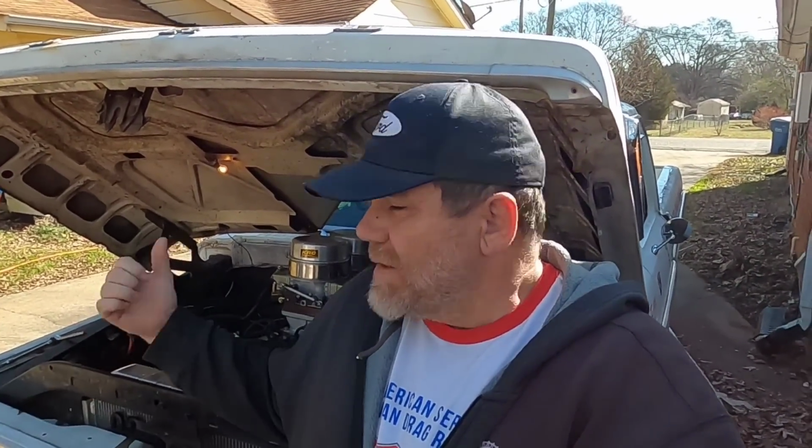And it's topped off with 2 Dominator carburetors. So getting back to that whole streetability thing, this would be my first crack at trying to tune Dominators for the street. I think it'll work. There's a lot of similarities to the 4150, with the exception of the intermediate circuit, which is in these carburetors. It'll be interesting to see when the intermediate circuit comes in versus the transfer slot. So I'm going to dive into this thing.